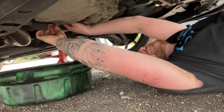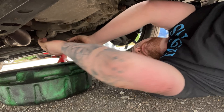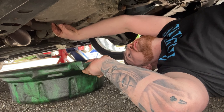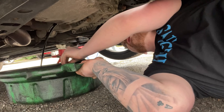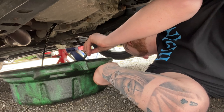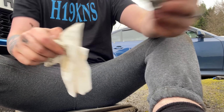I'm going to undo the sump plug now - hopefully it's not too tight. Oh it is tight. Right, got it. Just be ready because this shoots out - make sure your bucket's in the right area. It'll start dripping as you loosen it, and then as soon as you take the plug off make sure the bucket is positioned right and it'll work its way forward. Just let it do its thing and get as much of the oil out as you can.